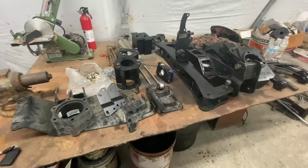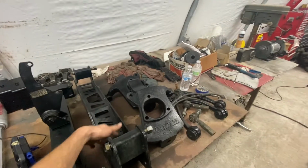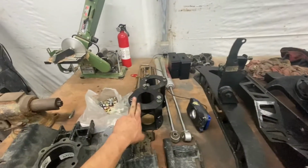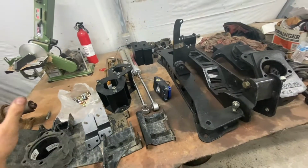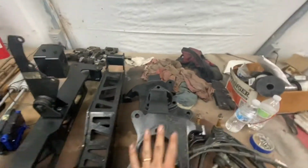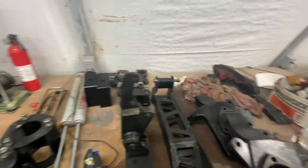And now let's move back on to the truck. All right, so this is the lift kit we got. It's a full kit. It's got everything. The front axle actually drops and sits on these two cradles, which is also where the lower control arms bolt to. We got lifts for the strut, new skid plate, all sorts of miscellaneous brackets and stuff. Lift spindles for the front, the back. We got some blocks, new shocks, and some new U-bolts back there.